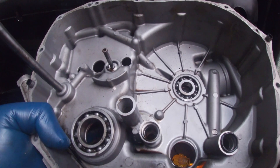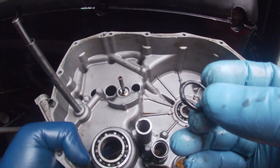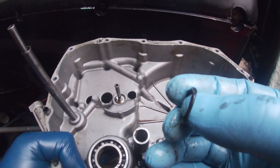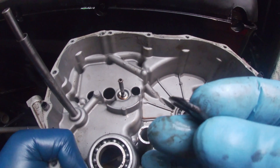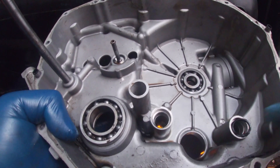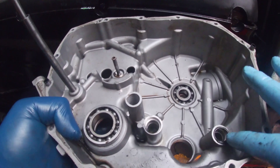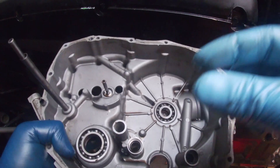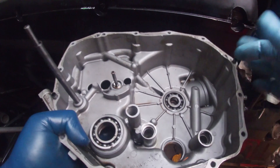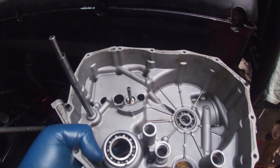When you're putting your new O-rings on, I would just replace both of them. I showed you the one that was cracked or ripped. This other one looks okay until you look closer and you can see that it's been smashed right there — and when it's smashed, you're going to lose oil pressure still. When replacing your O-rings, do not put the O-ring in the case side. You want to place it on the oil pump side. If you place the O-ring on the case, when you reassemble, as soon as that O-ring meets that sharp brass circle or inlet on the oil pump, it's going to shred the O-ring again. Put the O-ring on the pump, then carefully put the cover on the oil pump, and that will make sure your O-rings don't get ripped or smashed again.